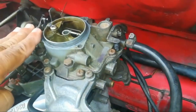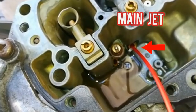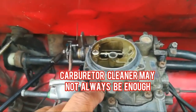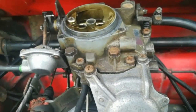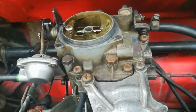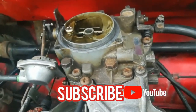The most common things that go wrong with these carbs are the idling jet and your main jet — those tend to get clogged up with little bits of debris. From time to time you have to open up this carb. Sometimes carburetor cleaner works, but it can be a good thing to physically open the carb. Many people don't like to mess with the carb and would rather give the job to a specialist, but it's not a very difficult job. Inside the carb you'll find dirt that clogs up your jets, causing trouble starting, jerking, and poor idling.